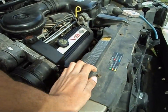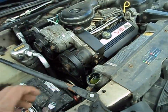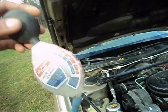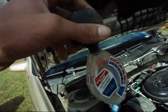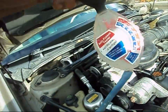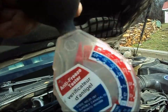We're good. Rad cap removed. I'm going to take my anti-freeze tester — engine coolant tester. It's not used very often, only twice a year, so there's dust on it from sitting in the toolbox. There's a gauge in the center and you've got to make sure this gauge is perfectly vertical, not to the left or to the right.